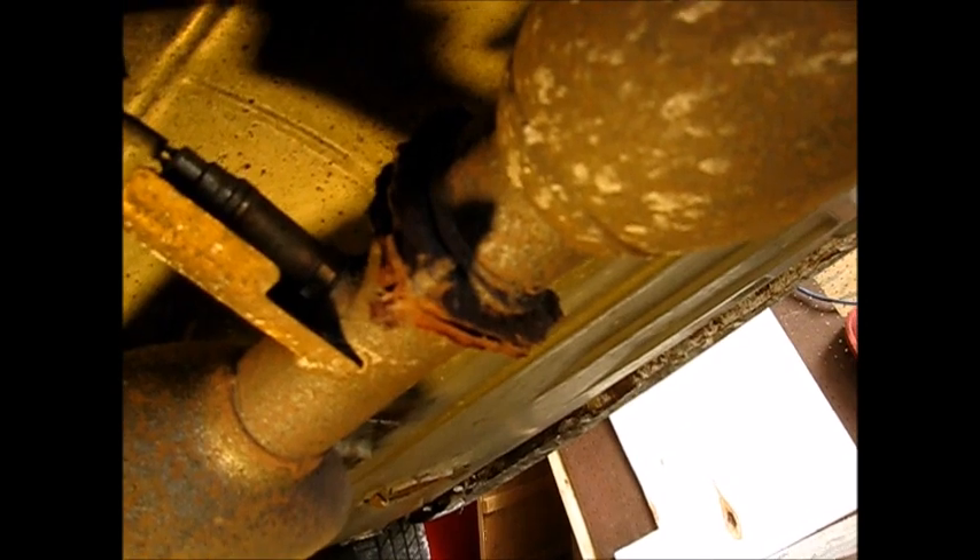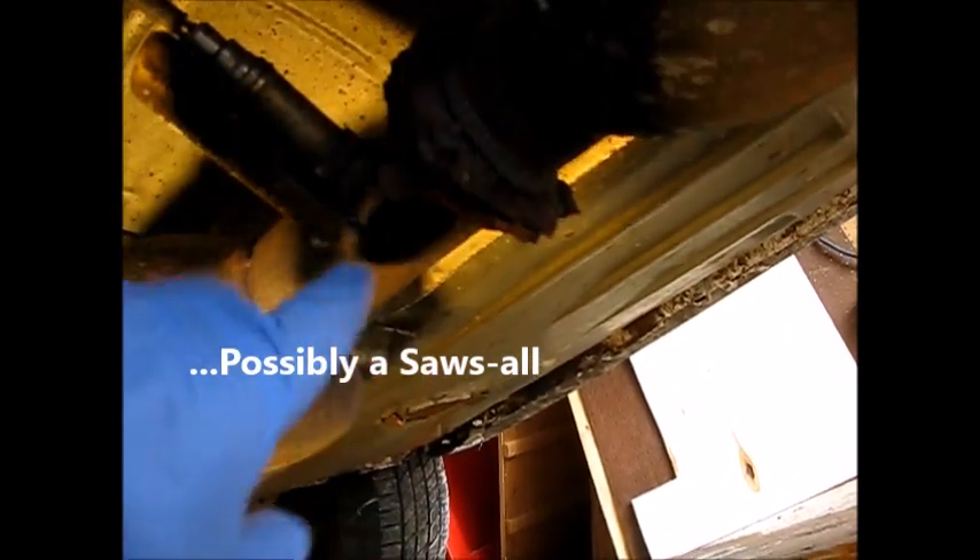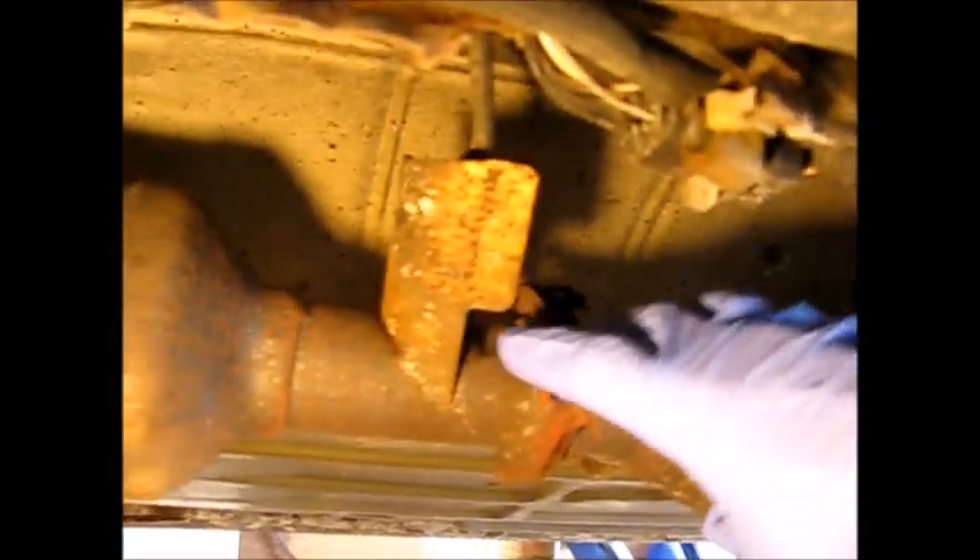In addition to the loud noise coming from here, my plan is to use whatever means necessary — angle grinder as much as possible because it's far easier, possibly a handsaw, possibly a Dremel tool. We're gonna cut this right close to this flange, this pipe, the same thing on the catalyst side. Then I'm going to put a butt splice in there — exhaust 2-inch butt splice, 2-inch diameter pipe OD.